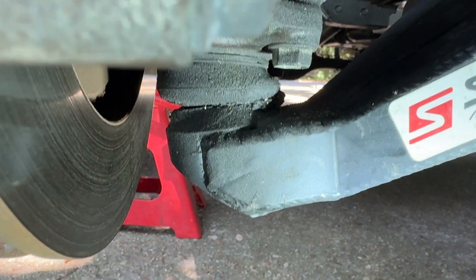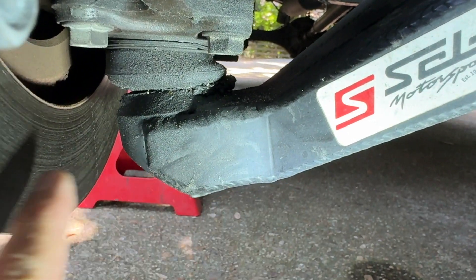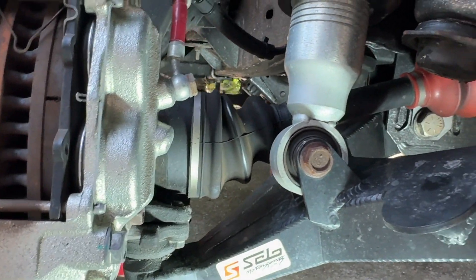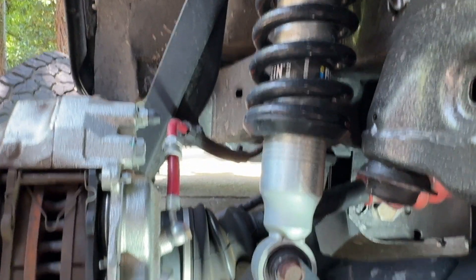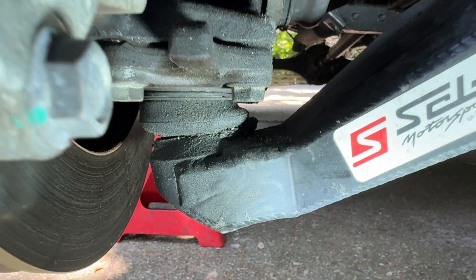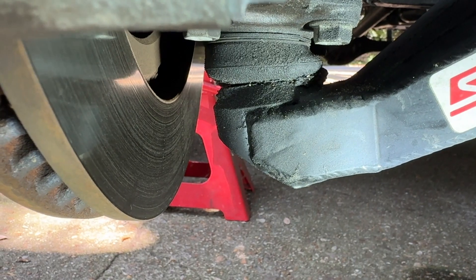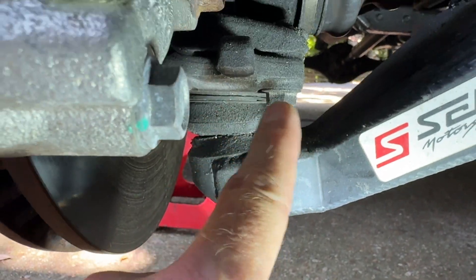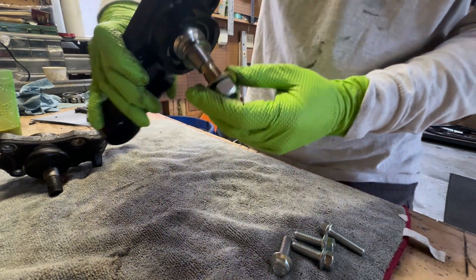You can see the plane of the ball joint is in a straight line, and the plane of the lower control arm is at an angle. I'm not binding because I've installed a proper suspension system, but for folks running spacers or springs lifted too high, it's really easy to get into bind. A lot of guys are banging into bind at full droop without even knowing it, which puts force on the bolt through the ball joint and can also shear these four mounting bolts.